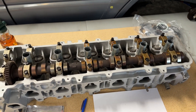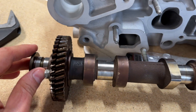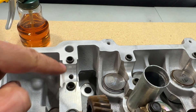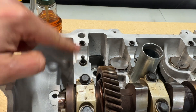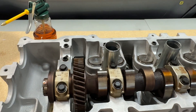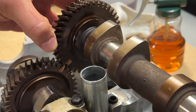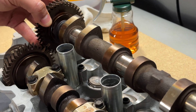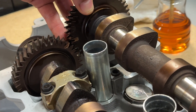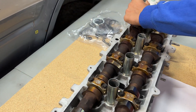I'm going to leave all of those — no need for adjustments or swapping of shims on the intake side. Now we're going to work on the exhaust side. We've got our exhaust cam all cleaned up, degreased, and blew it out with compressed air. We took all the cam caps off, we're going to blow out all of these holes with compressed air, then get some assembly lube on all of those surfaces and on the bottom of all the cam caps. Now we're going to put this on — get it lined up, get the gears in mesh, and roll this down, making sure they stay in mesh. Now we're going to torque those down to 12 foot-pounds.